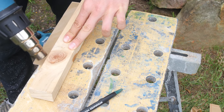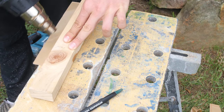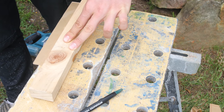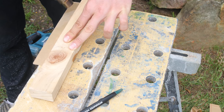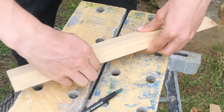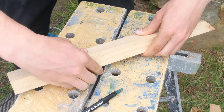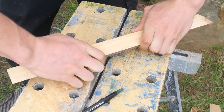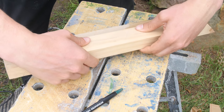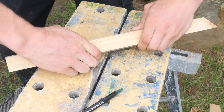For this next section I'm making the IO cover. I'm heating a bit of acrylic so I can bend it around and down and connect it to the actual motherboard armor to create one separate piece. I'm heating this evenly and using a piece of wood as a 90-degree bend guide to make sure I get a nice bend in the acrylic. I'm pressing down to bend it and then using my hands to further increase that bending.